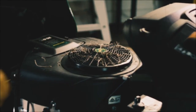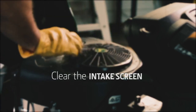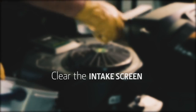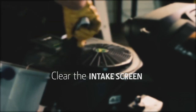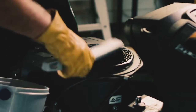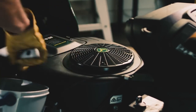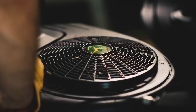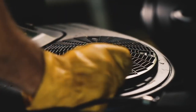Make sure the air intake area is free of debris. If you find a mess like this, remove most of the debris by hand, then use a brush to remove the remaining material. You can prevent this kind of excess build-up by checking and cleaning the engine each time before you begin to mow. It's always best to do this cleaning when the engine is cool.